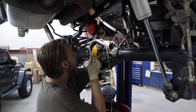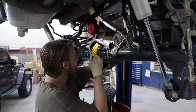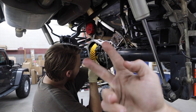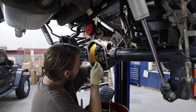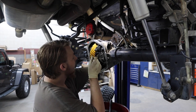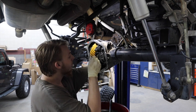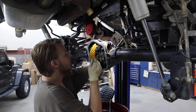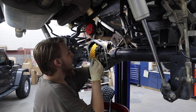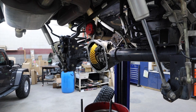You need to put as much paint on there as possible. After going back and forth twice, we were able to get it within spec — six thousandths. I'm not even going to tell you what the shim packs were that we put in because it really doesn't matter; every application is different. A lot of back and forth. Now we're going to run another test pattern — fingers crossed that we are good to go.